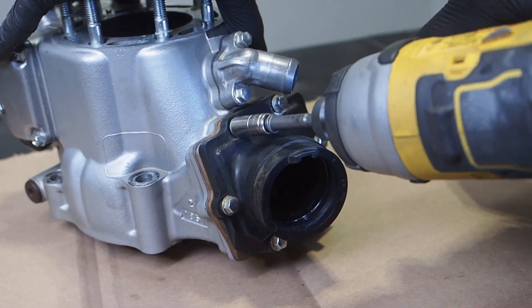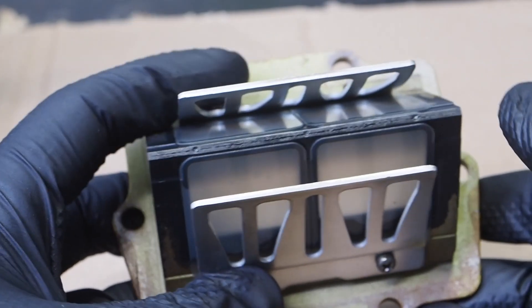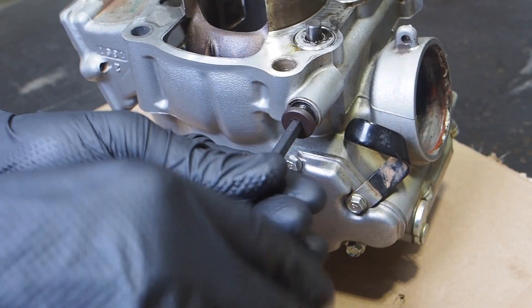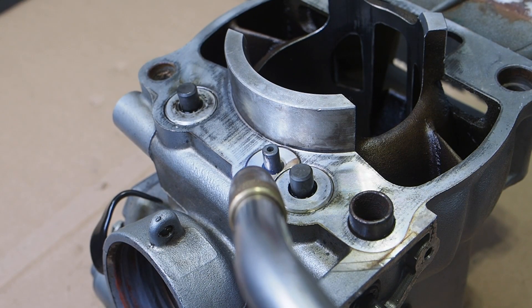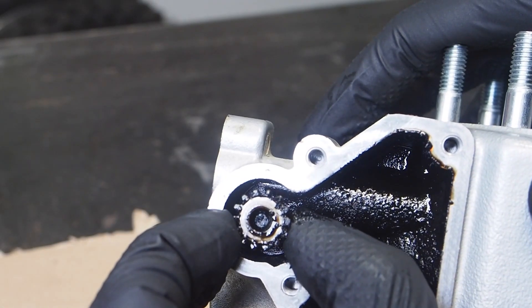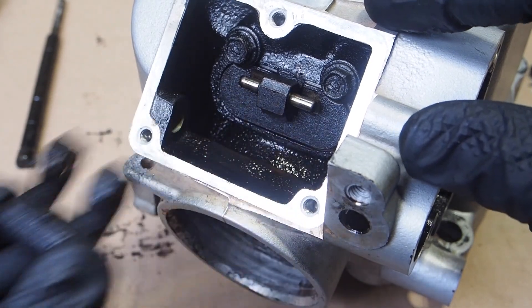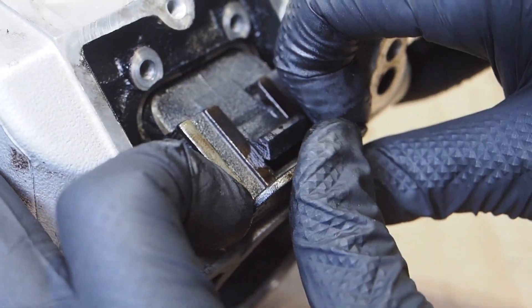We'll get the reed valve removed. This thing was actually still in great condition. The gaskets on this bike were just trashed, but the reed valve was in great condition — reeds aren't chipped, there are no gaps. If you look on the inside, you really want to look for light through the reed valve, and those petals are still really tight. Next up is the power valve system. This is where, if you don't have this specific Kawasaki two-stroke exhaust valve system, you're going to have to refer to your manual. For not having been opened up in 23 years, you can see all the nasty carbon buildup inside the power valve system. Before you throw your top end together, you really want to get the carbon off all the valves and inside the cylinder. I've got a video on how to do that over on my channel.